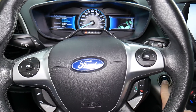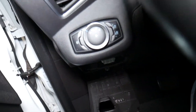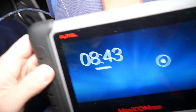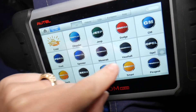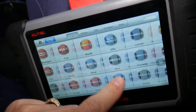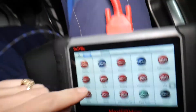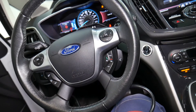Now let's go ahead — I'm going to turn the ignition on without starting the car and grab the computer to scan it and show you. You need to find your OBD port, plug it in, and connect. If you need a good scanner that can pay itself off in one use and works on any car, this is a great piece of equipment. I'll put the link in the description below. We'll select auto-detect and it's going to read the VIN number, ask us to confirm, and decode that information.